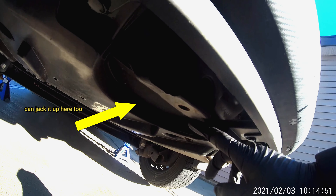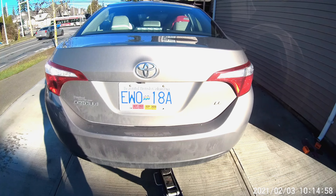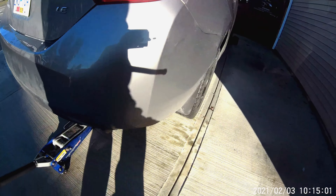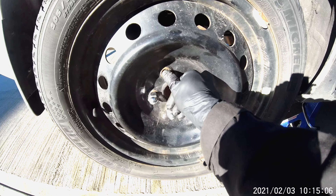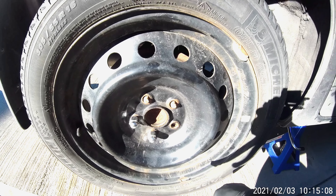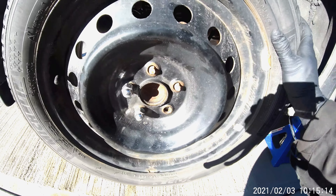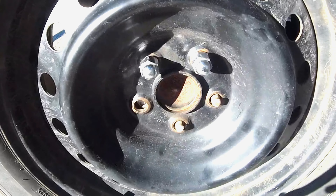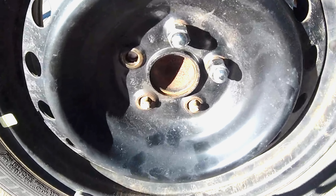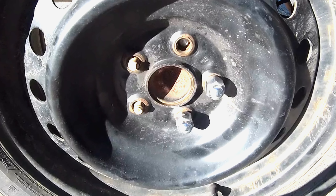You can also lift it up from here. This is a 2016 Toyota Corolla and today we're going to replace the wheel studs — drum brake wheel studs. You can see they're broken up, there's only two wheel nuts left, so we're going to remove the two and see what happens.